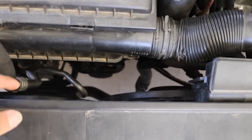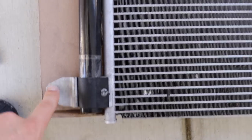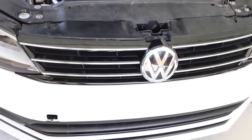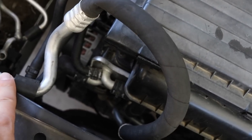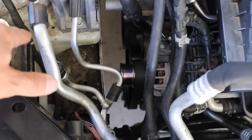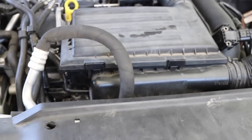I have to rip it out. I'll probably need to take out the radiator fans and the radiator to get to the condenser, since the condenser bolts to the radiator with four bolts. I'll try to minimize the workload as much as possible. One concern is the AC lines have been bent out of shape and there's a kink in the rubber hose. I'm going to have to gently bend everything back into position — it's supposed to sit way lower, below the hood line.